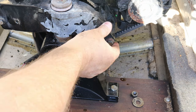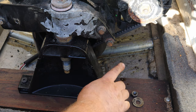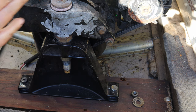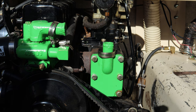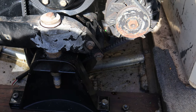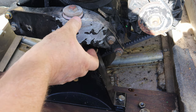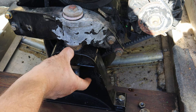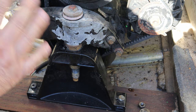Here's the old thermostat — the new one is in there, all sealed up and ready to rock. Motor mount is reattached back to the block, setting back down. I'm going to get some fresh bolts, fresh washers and nuts to bolt it back down. This nut had backed off and was sitting way down here out on the water — but the nice thing is none of the stuff had actually moved, so the height adjustment was not impacted at all. I'll make sure it's good and tight, sandwiched and locked in place, then we're going to the back of the boat to start putting the outdrive back together.